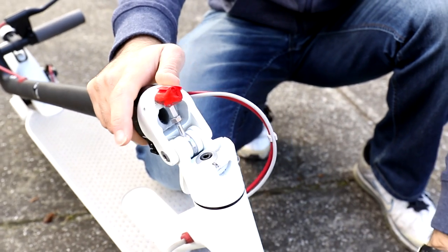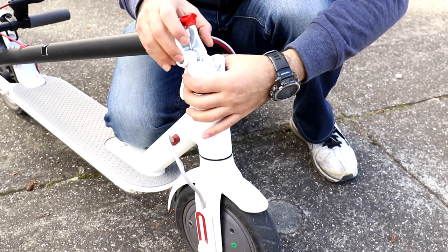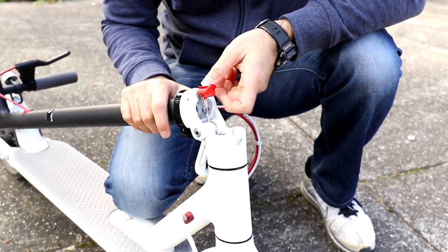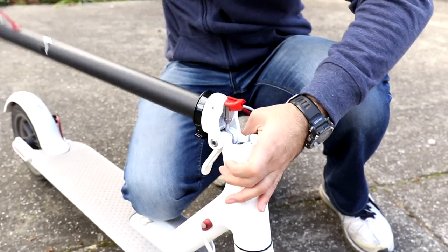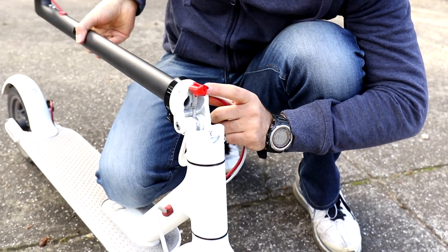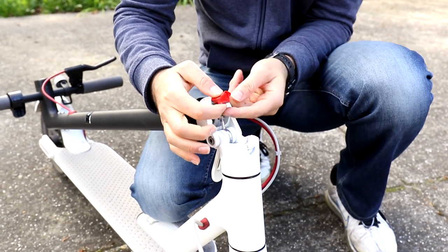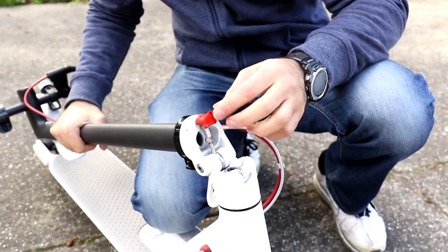With what I mentioned about the small tires and no shock absorber, everything will be transferred, the shocks, through this and this. All the small shakes and big shakes start shaking this, and these two metal parts are grinding on top of each other. After a couple of weeks, I noticed this was becoming loose, and I needed to keep adjusting it from the screw there and the washer there, so it becomes tighter. Then I reached a point where I couldn't adjust it; it was at the limit. Then I put this silicone tape there, so the metals are not touching. Basically, every 2-3 weeks, I replace the silicone.